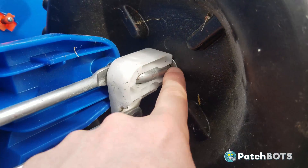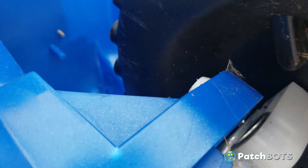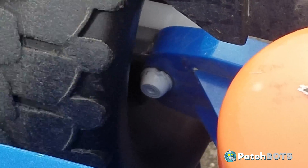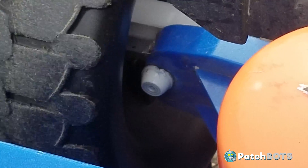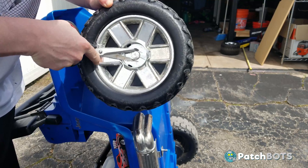Looking here, we have our axle coming off of the wheel. It makes a 90 degree turn and comes out through the blue plastic and is secured with a white push nut. The force applied to this metal axle has been slowly wearing down the thin plastic hole that it's going through, making the hole bigger, and now the axle has a lot of extra wiggle.